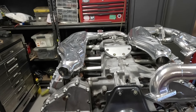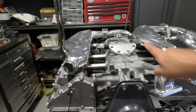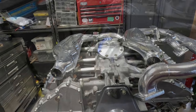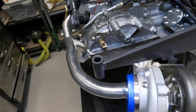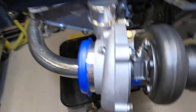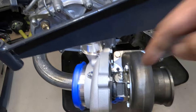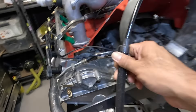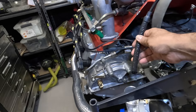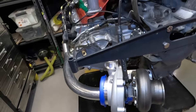I'm going to stop the video and turn the engine back up just to show you the turbo sitting on the flange and the angle of attack to get to the sump plate. So this is the turbo mounted and I've clocked it - I've undone the bolts here and rotated it so that the oil feed is pointing straight up and down and then the drain will be coming out the bottom. That's the oil supply line from Turbo Craft - so that goes like that and then that goes on there, and that's why it's so long. My wide band plugs will come somewhere around here.